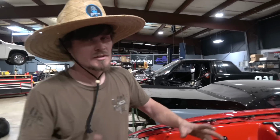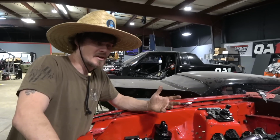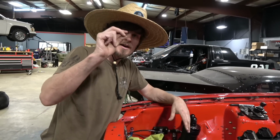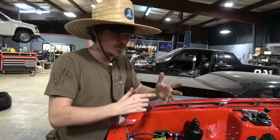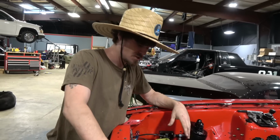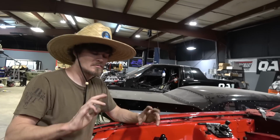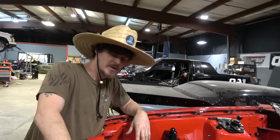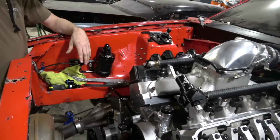And look at the orifice size inside your regulator, and you don't have an issue. If you needed to flow that much, that ball valve in there is just a ball in a seat, and it has no kind of surface area. It's not even flowing that much, so it's not a restriction. So don't get all hung up on running Mondo fuel lines, because you're just wasting money. The larger the fitting, the larger the cost.